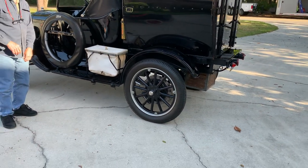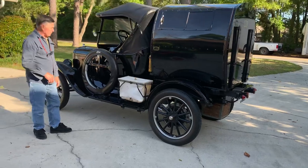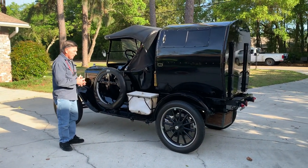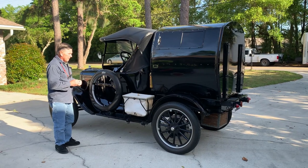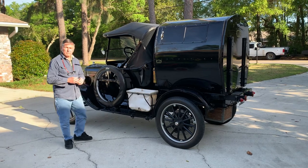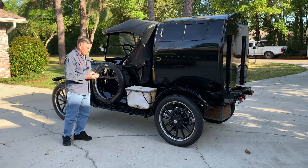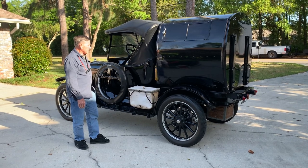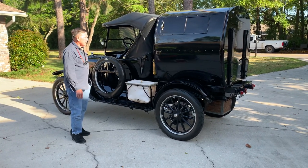For storage, you should shut the battery off. But before doing that, like with all Model Ts, you should run the carburetor dry. There's another fuel shutoff on the engine, but Herb hasn't used it. To keep the best possible storage, you'd want to shut off the fuel at the gas tank.